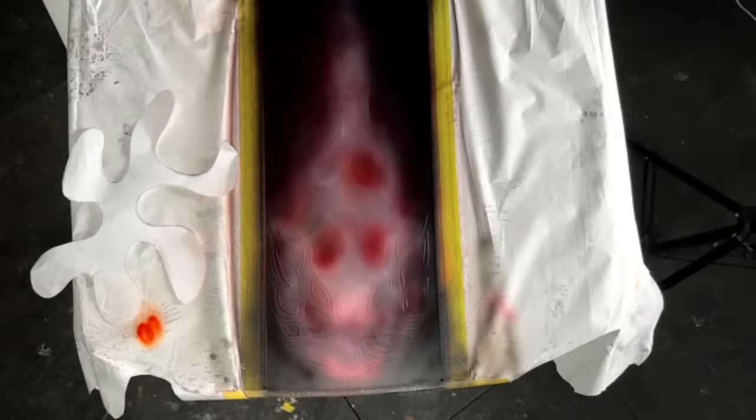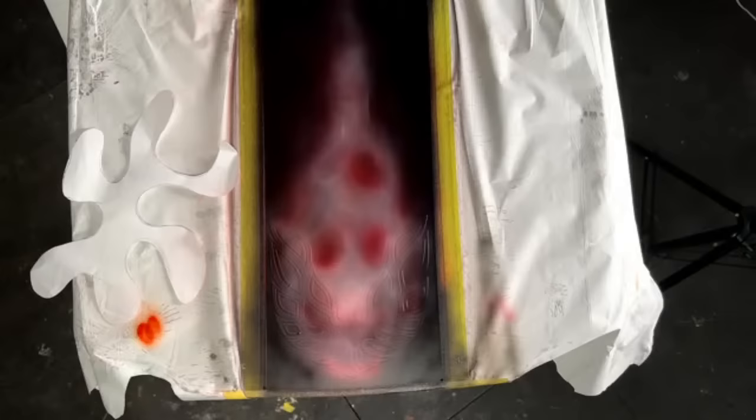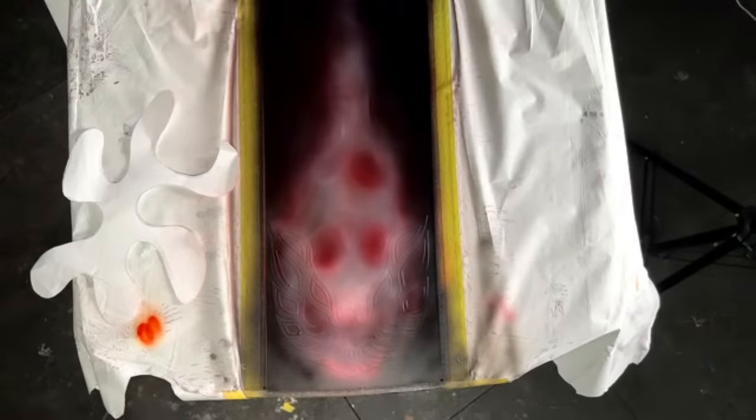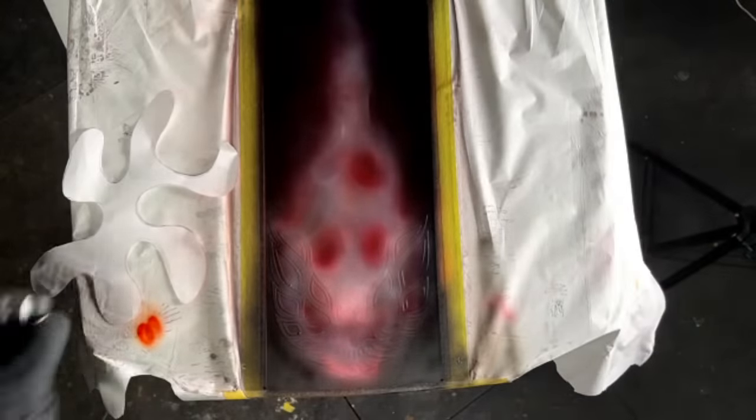Steve says, I'm painting my tank bright orange. That base color doesn't have flake. Should I add the flake to the orange base or use clear mix with the flake over the base orange? No, you would. So you got bright orange, and he's looking for a metallic in it. So yeah, I would probably throw a metallic orange over the top of that. A couple of light coats. If you use a regular metallic silver, it's going to have silver specks on it, and that's probably not going to be the greatest look. Unless you're looking for that, but maybe just a little bit of metallic orange. I know we have that now, that metallic orange. If you've been looking for it, we've been out of stock on that for a while.